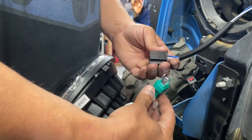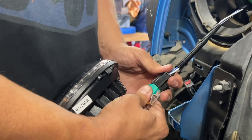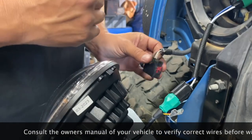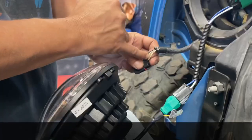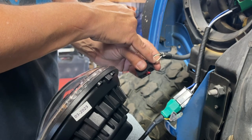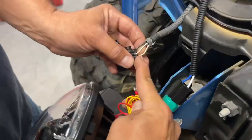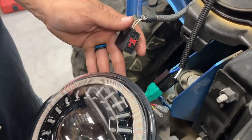If you're just doing the normal headlights high and low beams, you're going to hook your connection up like so. I usually tape these just to give it a little extra seal — it's a pretty good sealed connection. If you're going to do the halo ring, you're going to need to do some wiring. They send you this small pigtail which connects to each one and taps into your turn signal. The far right wire, furthest from your black, is going to be your turn signal. The middle is going to be your constant power — your daytime running light. Your yellow wire goes to the turn signal and your red goes to the middle, the daytime running light. That's going to give you your halo ring.